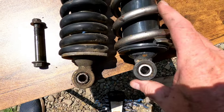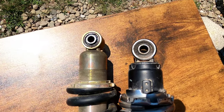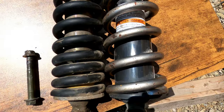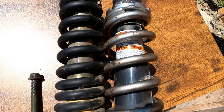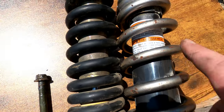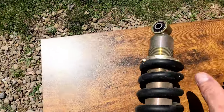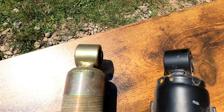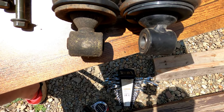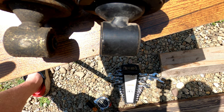Here's a comparison of the Hawk shock and the Ninja shock. I bought this used off eBay for less than $30 shipped, and you can see it's a little bit shorter — about an inch and a half, maybe two inches. I don't really care, but this shock is better quality. Japanese versus Chinese. The tops are pretty much the same size. It's just the bottom where you're going to need spacers — you can see how the stock shock is wider. So you're going to need spacers to fit in there. I'm not sure how many yet; basically I'm going to get a bunch of washers.